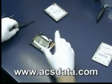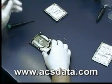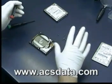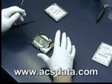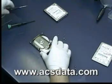If you hear the rushing sound of air in the background, that's actually the air coming through our clean room here — it's a class 100 area. It's not going to be to scientific standards as far as class 100; we're not working with DNA or anything like that. We just want to keep the internal components of the drive as clean as possible, and the air coming through here is much, much cleaner than what we have outside of this area.